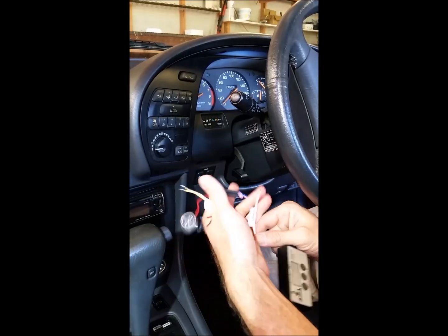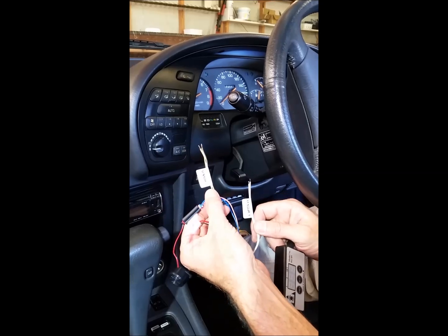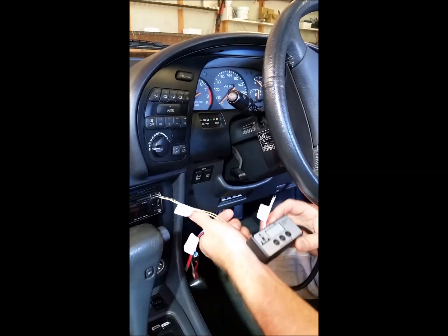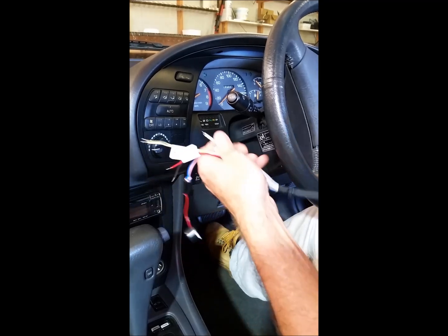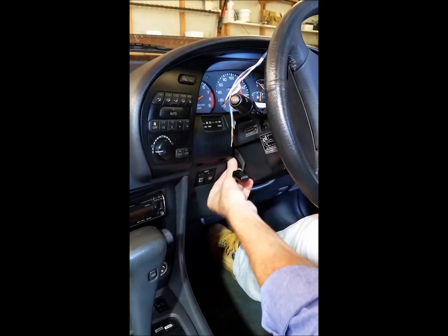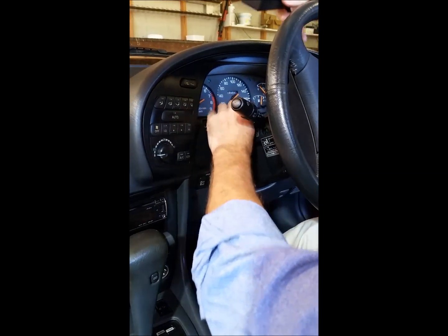Here's the buzzer cable, that's sensor 1, sensor 2 cable, and there's the power cables. What we're going to do is slide them down past the steering column and get the wires to drop out the back of the dashboard. All we need to do then is connect the wires up.